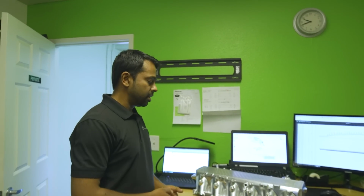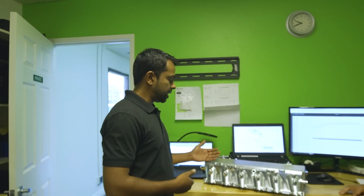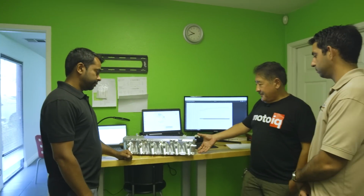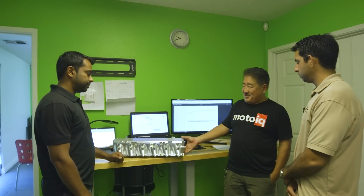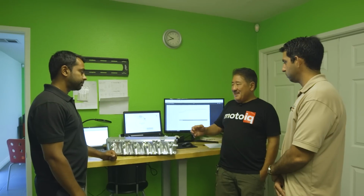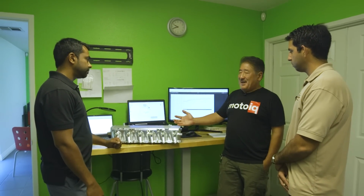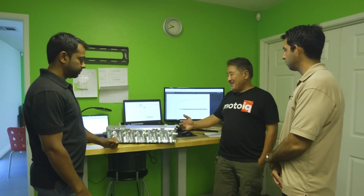And as we all know, engines are limited by cooling capacity. That's the peak challenge that most engines have. So reducing the temps and giving room for expansion and growth allows enthusiasts to target more horsepower. The other thing too is that your brick has so much less restriction. It's visually obvious when you see it that when you increase the mass flow with a bigger turbo, that's actually going to be way more beneficial.